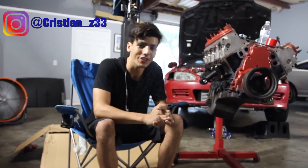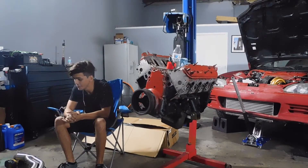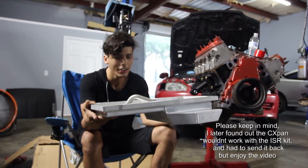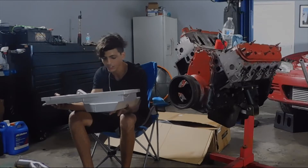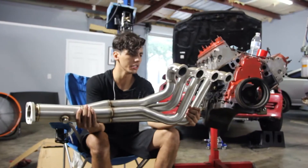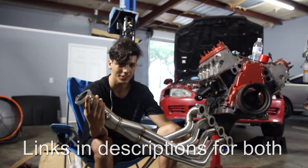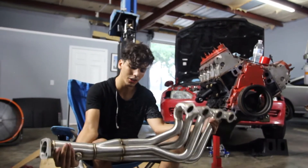What's up guys, welcome back to another episode. We're here at Pierce Automotive and I'm pumped because today we're actually gonna put some hours in on the new engine. The main things we're gonna do today are install these parts right in front of me. The first one is the oil pan from CX Racing — this is a front sump pan. You're gonna need a front sump because the normal ones are in the rear and it's gonna hit the cross member. I also got fresh gaskets for it, as well as these awesomely perfect headers from ISR. The cool thing with these is that while one side is for the LS, the other side's flange is perfectly matched for the 350Z's existing exhaust, so I won't have to get a new cat-back. Let's start stripping down the old parts and then put the new ones on.